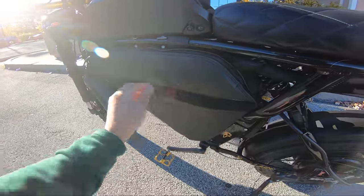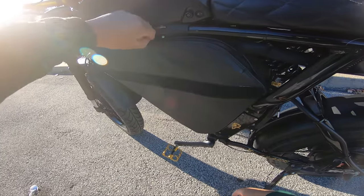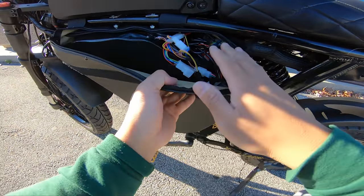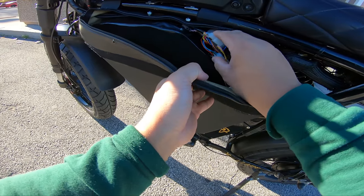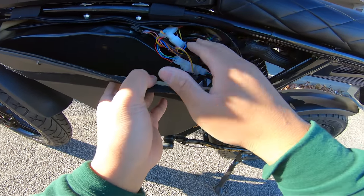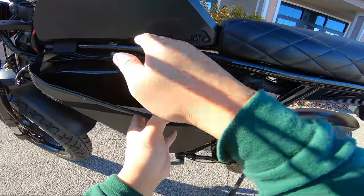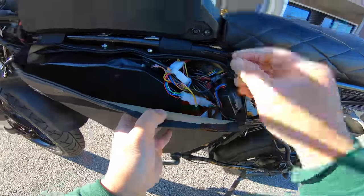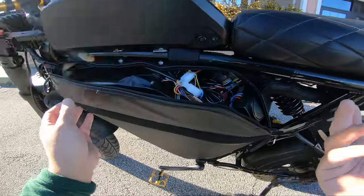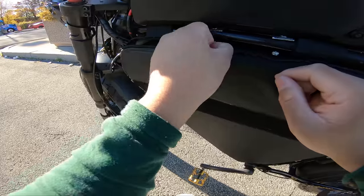Let me show you guys the full frame battery bag. The full frame battery comes courtesy of Powerful Lithium — they did a great job with this pack in terms of sizing it. We got the DC converter kit in here as well as the other wiring. The way they shaped the battery actually gave space to put a lot of the other components on this side of the bag. I know it's kind of a rat's nest, but it was a lot better than when we had the original tank bag. It's a lot more accessible — you don't have to go digging through a small bag trying to find the brake wire or throttle sensor. Big shout out to V for making that space in the battery bag.